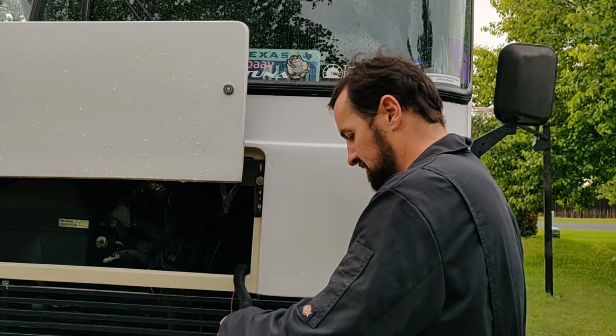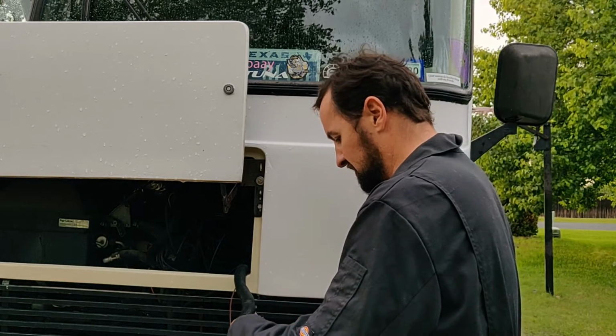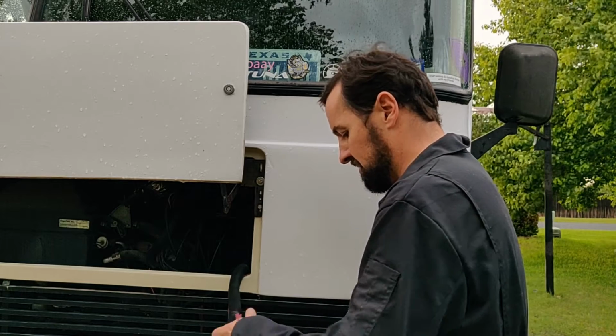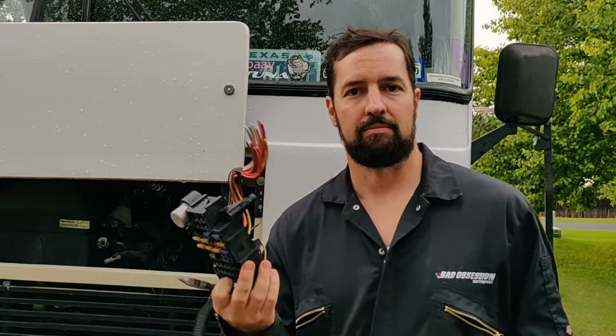The first thing to do is to cut out the old fuse box. If you find 2 or more wires with the same color, be sure to label them before you cut them. I forgot to do this and it almost wrecked me. Luckily, I was able to match up the cut ends and figure out which wire was which.